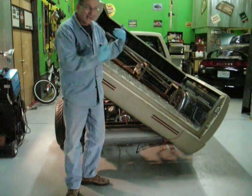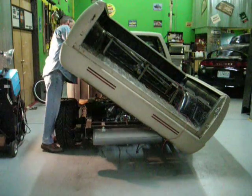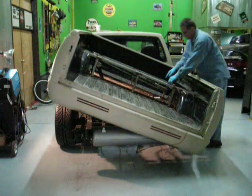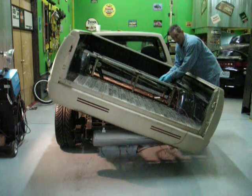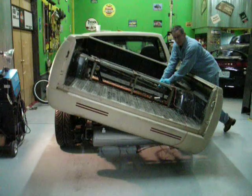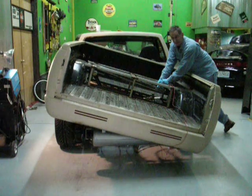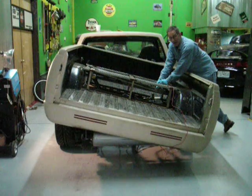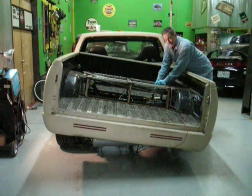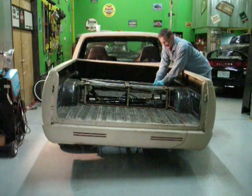It's got it very secure, but I need it to come back in order to go down. That's why I put the bungee cord on there — it's kind of hokey at the moment, but it works. That's as far as it will go with the actuator doing all the work. I've reversed the polarity on the switch, so I'm grounding the positive and now I'm putting power to the negative. If you need any information on how to wire up an actuator, go to hotrodbulletinboard.com or hotrodders.com — that's H-O-T-R-O-D-D-E-R-S dot com. You'll find a lot of good information; it's a forum. Those guys have really been helpful, because I don't like electrical, but I've figured out quite a bit.